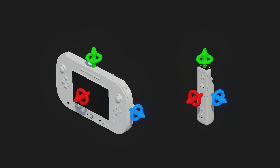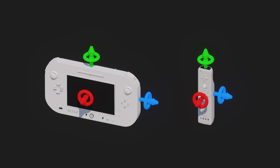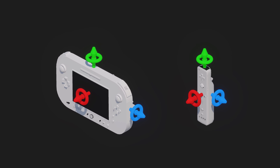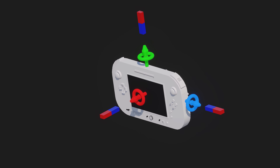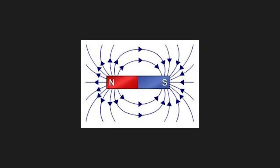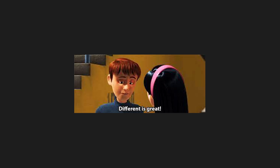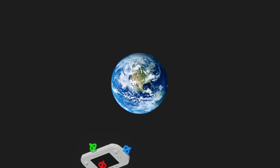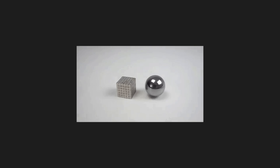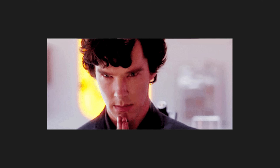Let's take stock of the Wii U gamepad and what it can do. Just like the Wii remotes, it has an accelerometer and a gyroscope. But it has something on top of that — it has a magnetometer. A magnetometer uses electricity to create a magnetic field. Then the Earth, or whatever you're standing next to, will mess up that field. This is a good thing because we can measure the difference and know where the Earth is relative to the Wii U gamepad.